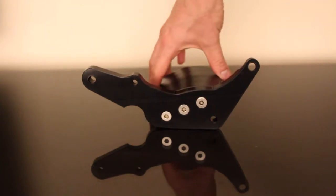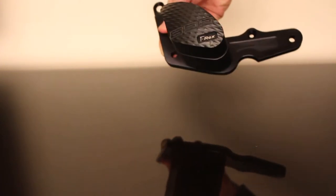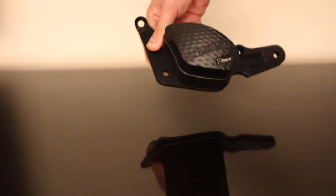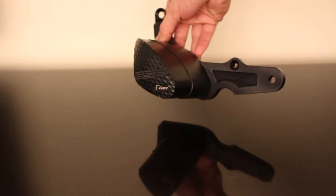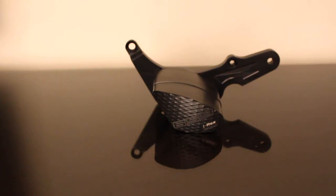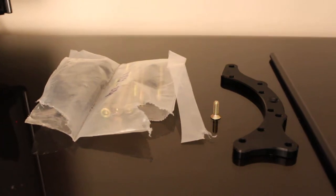This material is a little bit softer and tougher than Delrin — Delrin is a little harder but more brittle. What this means is: say you're going down on a low side and you had a cheaper aluminum or billet-based frame slider — it could impact and instead of grinding down slowly, it's going to transfer direct force to your frame, which could cause your frame to break and a lot of other damage. So it's good to have a material that's soft, that will go down against the ground and start breaking down.